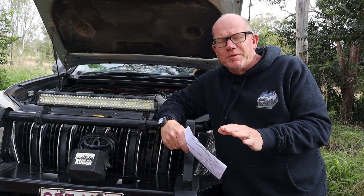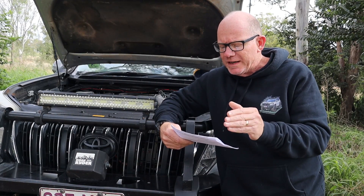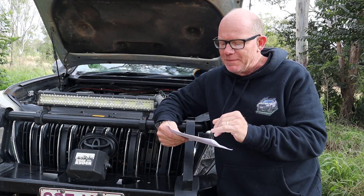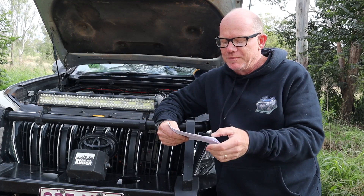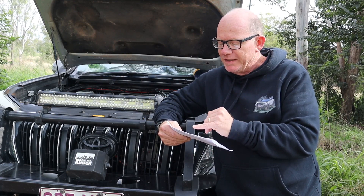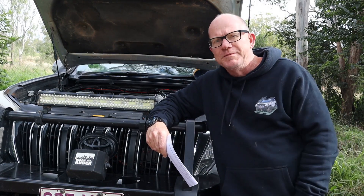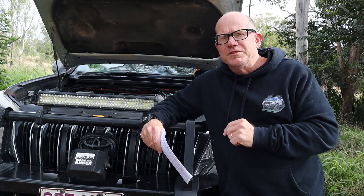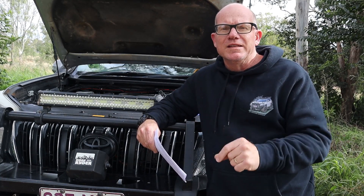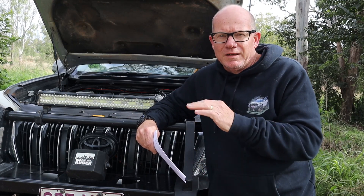The unit will always take as much power from the unregulated solar input as it can before supplementing that power up to the maximum rated output from the vehicle input. The dual input in-vehicle battery chargers are suitable for all types of automotive lead acid batteries and lithium batteries. So if you're driving down the highway on a bright sunny day with solar on the roof, it will use the maximum power it can from the solar and the least amount from your alternator — less strain on the engine.